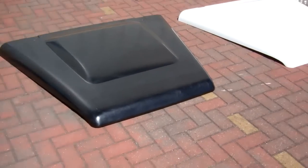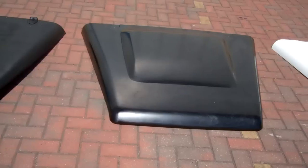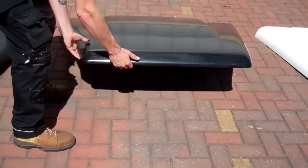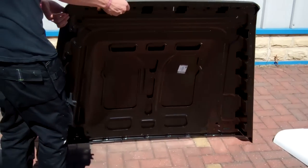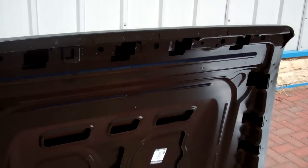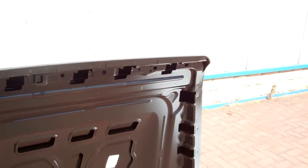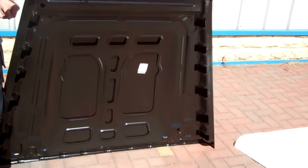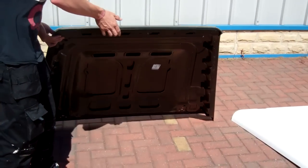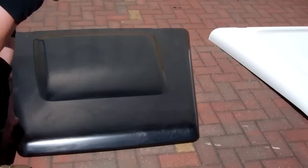Ian, do you want to lift up and show what it looks like underneath? With the steel bonnet you've got a full double skin construction underneath, with areas where you can add soundproofing. It fits the same - you can swap it straight over from the standard bonnet, just drop it onto the hinges, swap over the bonnet catch, and everything lines up. You've just got that nice power bulge.